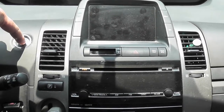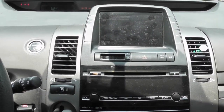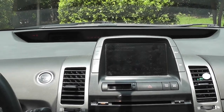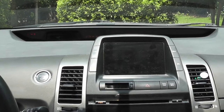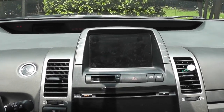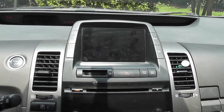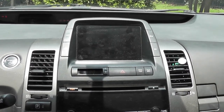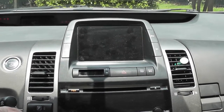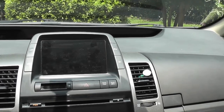I'm going to energize the car. It appears to be starting up normally. I do see check engine lights — ABS, VSC, and so on. I'm going to try driving. I don't see the engine cranking up. No sparks or smoke reported from the back. I don't appear to have power, but I'm going to try putting it into gear. I'm going to take the brake off and put it in reverse — nope, definitely don't have anything. Putting it into park and powering down.